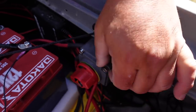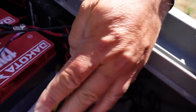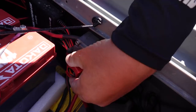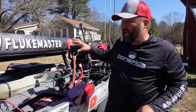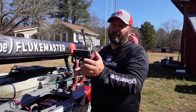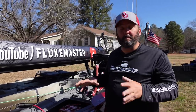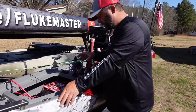A lot of people ask about this switch panel — this whole panel was done at Westbrook Supply Company, my paddle shop. I'll leave a link to them in the description. This is a dual battery switch, and the reason I have one is for redundancy. If I've got a battery that dies, I have a 60 amp-hour up front and a 100 amp-hour in the back. I can run them both at the same time for 160 amp hours, or run one or the other to change my weight distribution, because I'm almost maxed out with this boat.